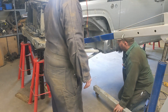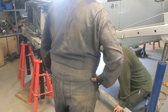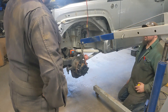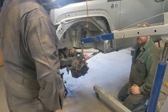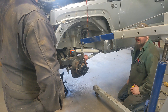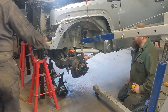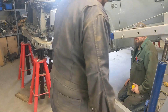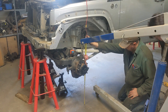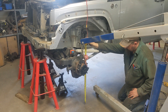That's the link from the bottom right there. Maybe we need to put the other second upper link on it - do you have any chunks of straight? That one link is taking a lot of stress. Where if both upper links were in, it'd be spreading that load. We're like a quarter inch short. Measure that for me - nineteen and three-quarters. I'm bleeding. Nineteen and a half. Yeah, nineteen and three-quarters.